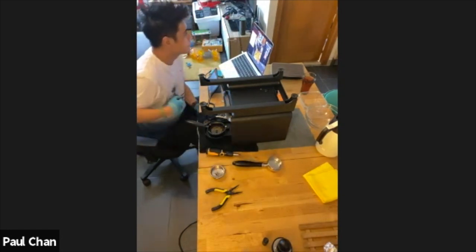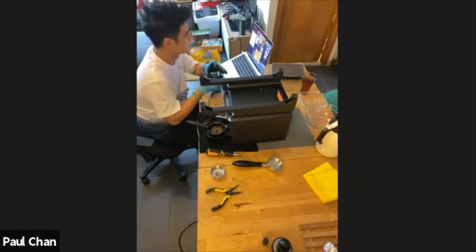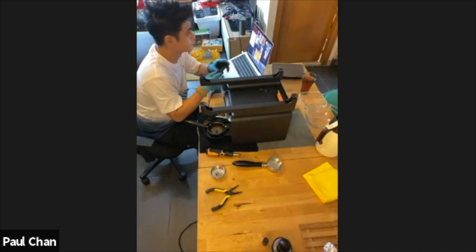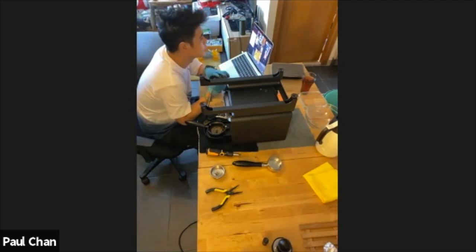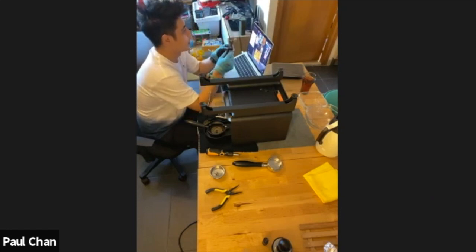I see. So I think most of the issue that causes the rubber seal to wear out fast is that I have this bad habit as well. After I read some posts in the forum, they were talking about not locking the portafilter overnight in the long term. Yes, I have this bad habit as well. I always lock tight, job done, lock tight, then switch off everything, go. That's also my issue; I changed my rubber seal right after I received my DE1, around the 3rd or 4th month. Always lock tight.